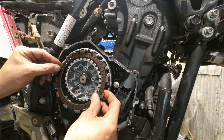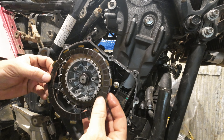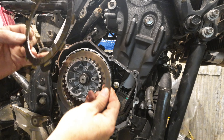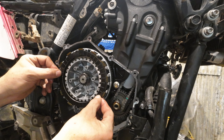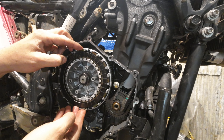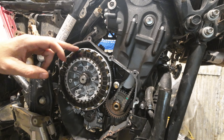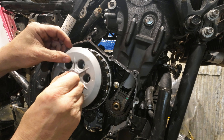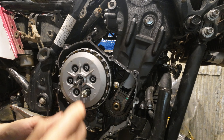Now you need to check on your specific bike. Often the last disc that goes on is different. You can see how wide these pads are compared to this — they're 50% bigger. I don't know what the technical reason for that is, it's just something I've noticed over the years. So most of these have been going in here, but this last one goes there. There are two sets of grooves and the regular ones go in here, then the last disc on a lot of bikes goes on differently. We're going to put the pressure plate on, and I'm going to check the manual to see the torque on these bolts.